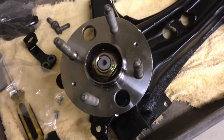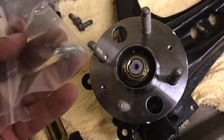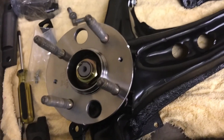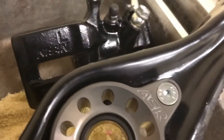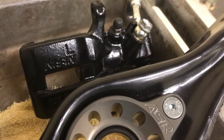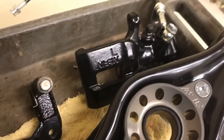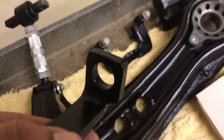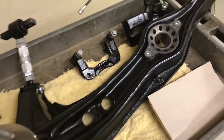Final assembly is pretty straightforward. You're going to put the rotor on using the two Phillips head screws — if you don't have them, once you put the wheel on it'll hold the rotor tight in place. You'll have two 14mm bolts for the caliper bracket. You're going to want to use the left side caliper on the right side so the e-brake cable is facing the right way. You're also going to want to use the right side bracket on the left caliper.